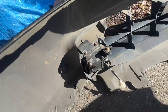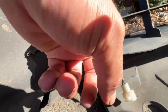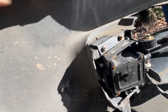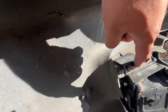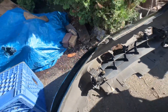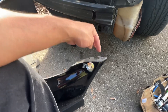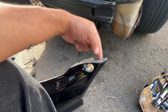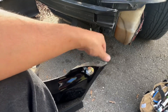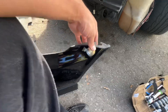This is the fog setup if anyone's interested - it's a clip that goes on the back over here. You're supposed to drill some things over here, just cut out whatever you need. Don't cut off this tab right here - I think there's some confusion about that. You need that tab to put on the bracket. That's pretty much it, then you get your fogs installed and do the wiring. We also have the quick release latches right here, and this is also a fix for broken tabs or a saggy bumper.